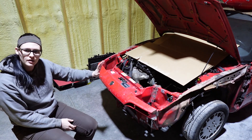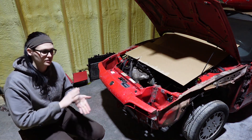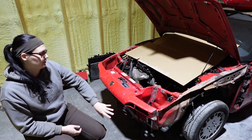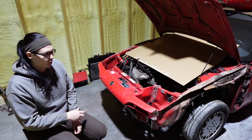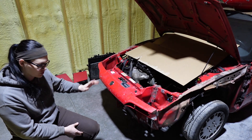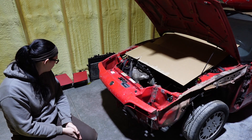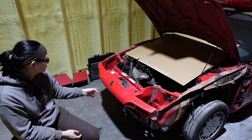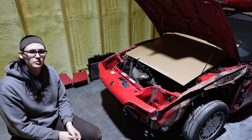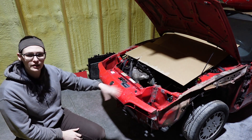I'm all finished grinding the welds smooth. The point of smoothing it out is just to get rid of the really obviously rough-looking weld so it's smoother and will hopefully blend in and be a little bit less noticeable. It'll be covered up by the headlights and the bumper of course, but I don't want it to be super obvious that it's been poorly welded. Next step: I'm going to clean everything — I vacuumed off all the metal shavings and swept up, there was a surprising amount just from sanding down the welds. We're going to do some surface prep, mask because I don't need to paint everything — just where the bare metal is — and then do some primer and paint.